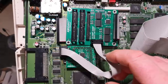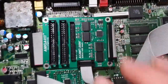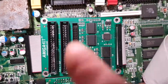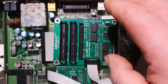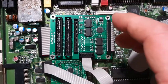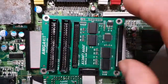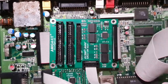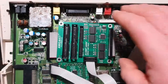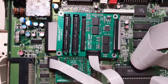So like I said, this will now allow any IDE devices that are plugged in to be buffered. On the IDE of the Amiga 1200 alone, or even an Amiga 600, it's not buffered — so this is now buffered, which allows you to use a long cable without getting data loss, which can really happen on unbuffered setups.